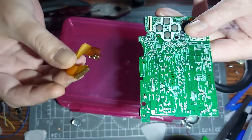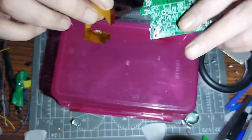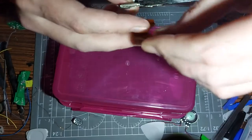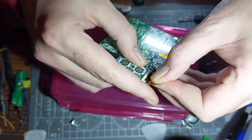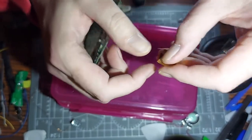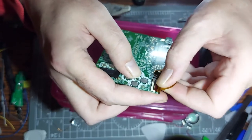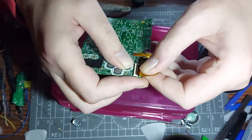Let's get this in place. When the gold connector is going in, you want gold down toward the board - don't get confused. Gold goes down, the brown bit pokes up. It's a bit of a pain to get in there. Get a firm grip - it needs to be quite sturdy going in and it'll slide into place. Obviously you don't want to break that clasp off. If you break the clasp you might even be able to find a way to solder speakers in there instead - something I'll be revisiting.